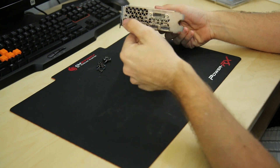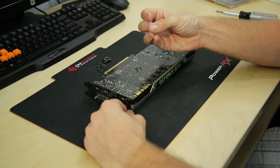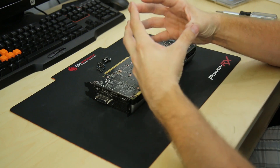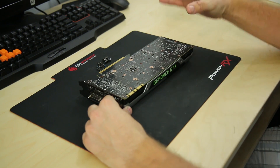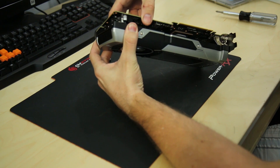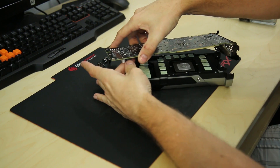Once you've double-checked that you've gotten all your screws out — the two from the front as well as everything on the back of the PCB — this is the part where you want to be gentle. You have cured thermal compound on the heatsink which acts like a glue, as well as thermal pads on each VRAM chip and the VRMs. Those are all sticky and it'll feel like the card isn't coming apart. If you're confident you haven't missed any screws, just start from the back and do a little wiggle — there will be a little flex in the card, don't let that freak you out. Don't just yank the card apart because you've got two plugs in the back — one for the LED and one for the fan — so be very gentle when unplugging those so you can use them again if you need to put it back to stock.